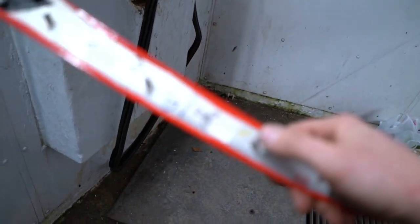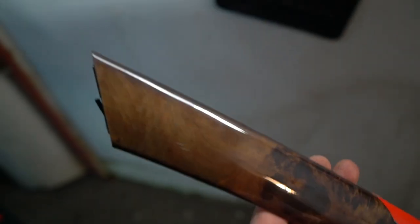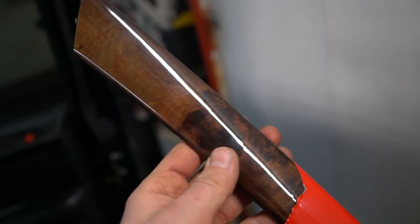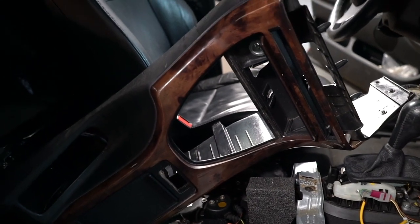You can really see how the old BMWs were quality made — these pins are aluminum, and this is an aluminum strip. On the other side it's covered with wood. I took out half of the part and here is the wood, but what happens is it starts to crack since it's a hundred percent wood veneer and it's just not pleasant anymore to look at. Also, right in this spot, all of them crack all the time — it's just inevitable. That's the problem with the wood trim.